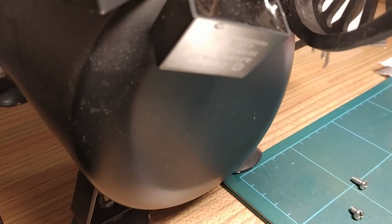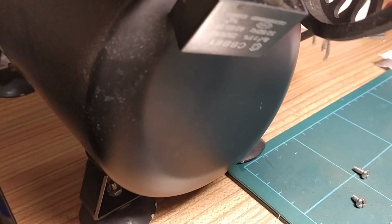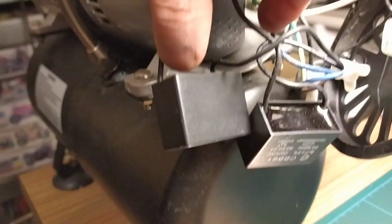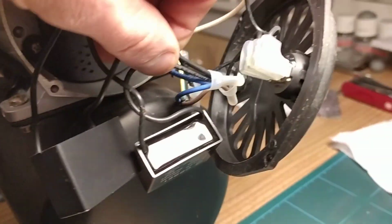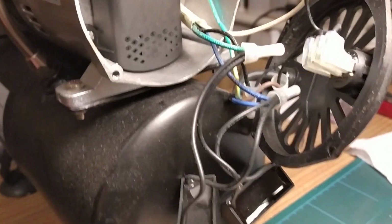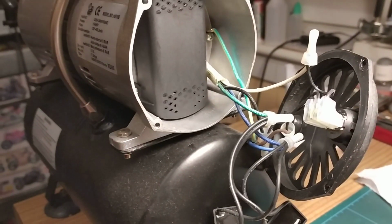And then the blue wire likewise, which has the neutral from the power lead going in, the blue wire from the compressor, and then it has the opposite two wires of the capacitor, both being opposite sides. Hopefully that tells you what you need to know and covers what you need.